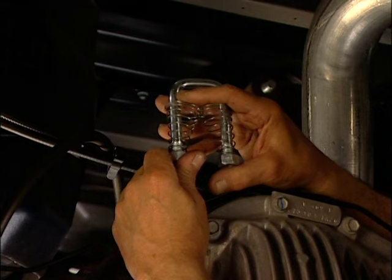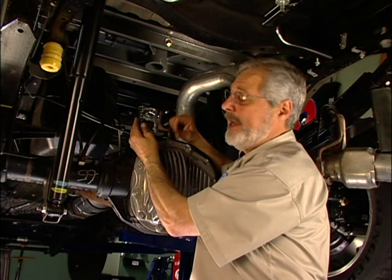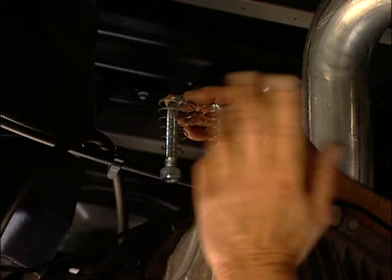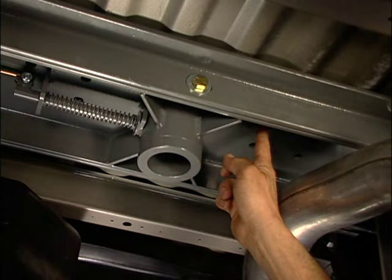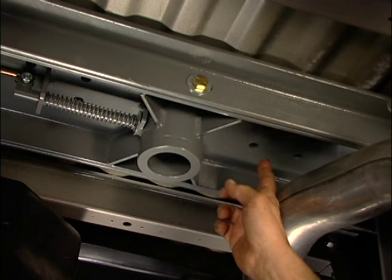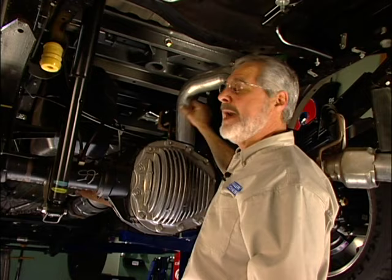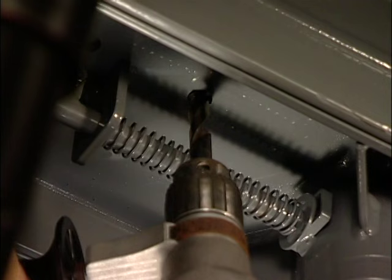Safety chains are a critical part of your equipment — that's why they call them safety chains. These U-bolts come down and your safety chain hooks hook onto them. They're spring-loaded with large tapered springs that taper down to the bottom; the large part goes up against the bottom of the bed. When you pull them up and hook your safety chain hook on, then take the hook off — bang, they snap back down. They don't rattle, and they're in the channel so your bed floor is flat. On this application, you drill the two holes closest to the receiver on both sides. Some holes are a little restrictive because of tailpipes in the way — use a long half-inch drill bit or a drill bit extender, or strap the exhaust out of the way and drill the holes straight.